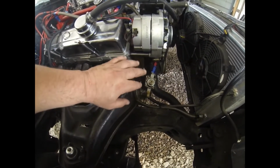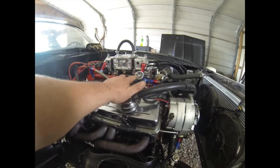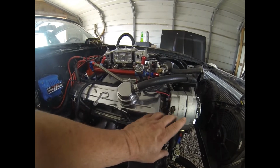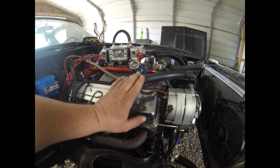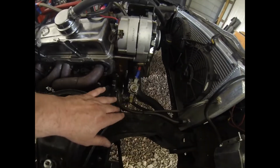safety switch. I put it on the gauge to like 5, and then I just set it to where it barely comes on, and any lower and it'd start pulsating and shut off. And then I put it back at 8 at idle, 8.5, that's what they call in this carburetor for idle. But put that on there.